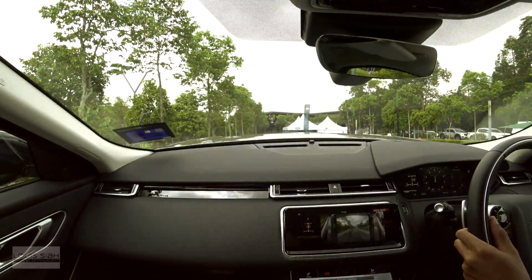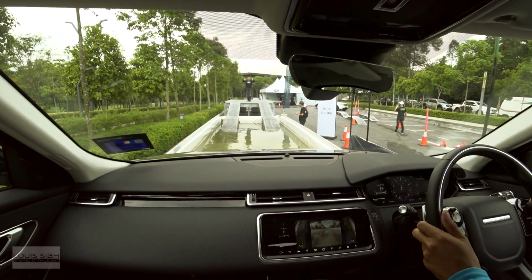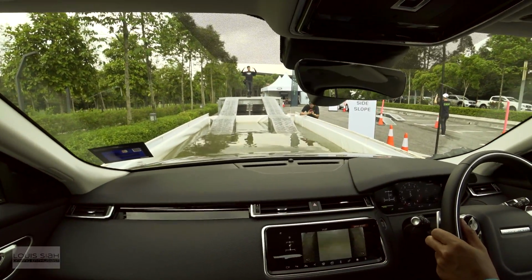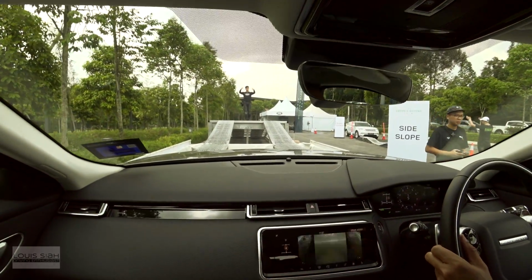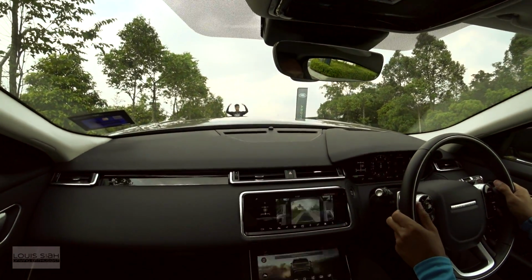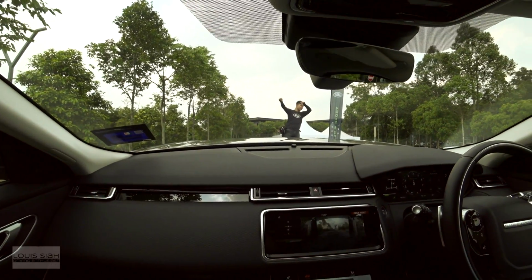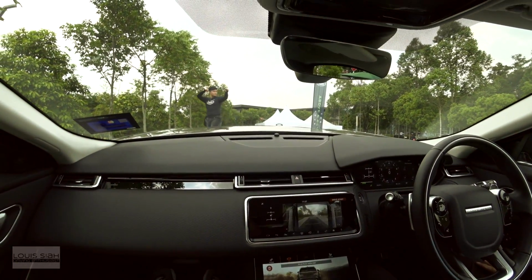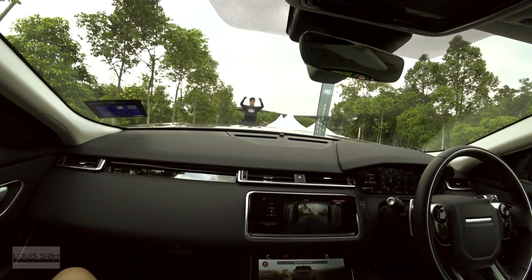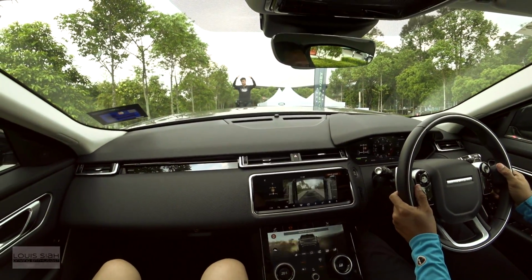It's important to get into the wading pool slowly. You don't want to make a splash. And also both hands on the wheel, and do not stop in the water. Just go in and continue. So when it starts flooding inside, then you know we should do something. We're not gonna be flooding inside because we're not stopping. So far, we don't have any water ingress into the cabin. So now we're just letting the water drip back into the pool before we continue. Okay, so now go forward.